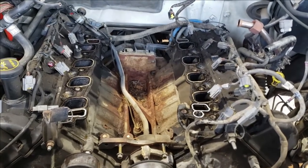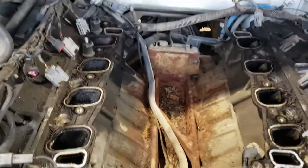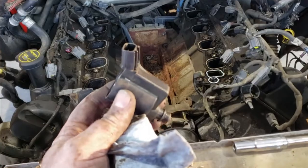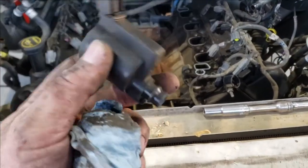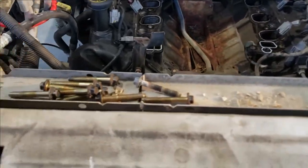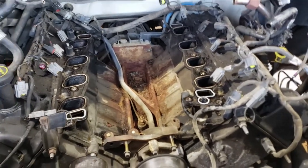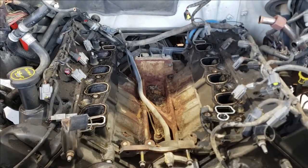The intake manifold is out. A couple of the plug boots stayed in — that's okay, just pull them back out. Here's one of the coils: that boot attaches to a barb and that spring goes up inside the coil. This one was broken — there were a couple that were broken — the plastic just rotted. If you want to do a really thorough job, these 20-year-old ignition coils can be found at a pretty decent price if you shop hard enough, so just give it a tune-up as you go.